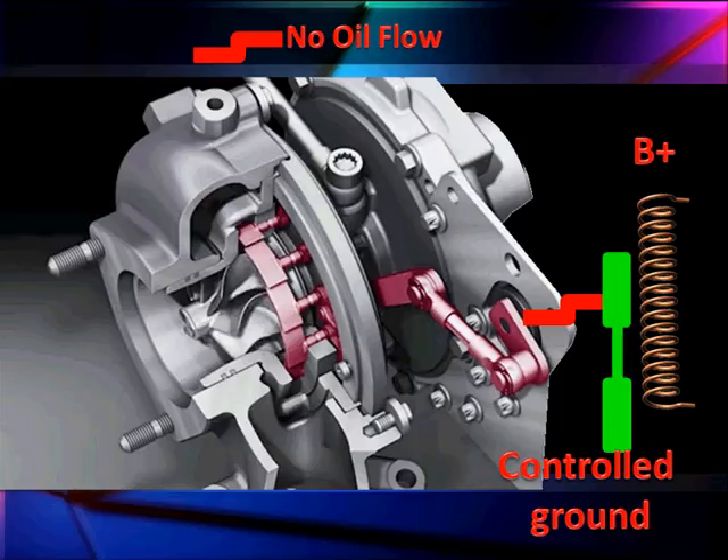Here we're at low speeds. We've closed the vanes. When we close the vanes, we get less air and we unload the compressor side of the turbo. It allows the turbo to spool up faster with the available power coming out of the exhaust. By unloading it, we get a higher speed and we don't need much boost at low speeds. If we step on the throttle, we increase exhaust flow, giving more power on the turbo at the exhaust side, and we open the vanes to let more air in. But our turbo is already up to speed, so we avoid turbo lag — that's the secret of the variable speed turbo.